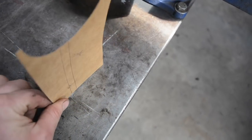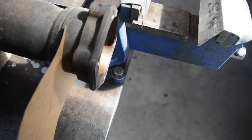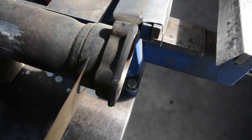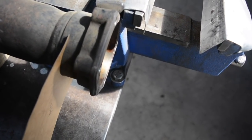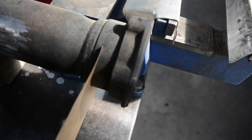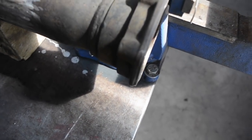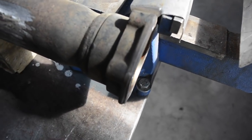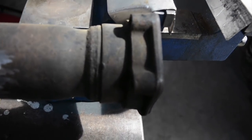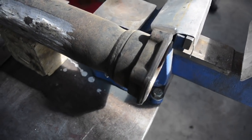The outside plate, which goes up against there, looks like it wants to sit up around here somewhere on this casting, whereas the inside one is fine, it's on the tube somewhere. But I think I'm going to run into maybe cert issues with welding it there. A friend of mine, Richie, who's building a Starlet, had to change it. I think they'd welded to there to start and had to change it, so I may have to get a bit fancy with that outer mount to bring it inboard to weld off the tube. It does seem a bit silly that you're not allowed to weld there. I mean, that's a big fat weld, but I can understand their reasoning for not allowing it for cert stuff.